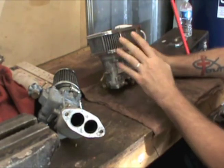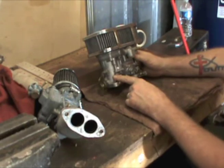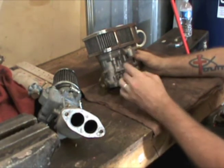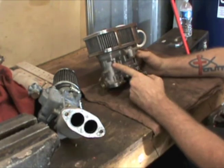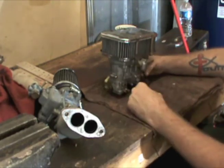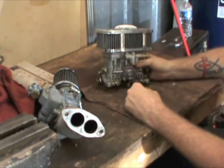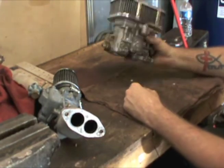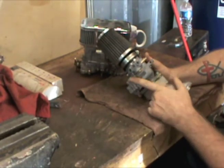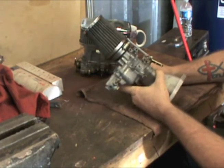I found IDFs are really good carburetors, but a lot of guys don't like the tuning involved. Some guys running sandrails and woods buggies will run a single ICT instead because they don't want the IDF exposed to all the dirt — IDFs don't tolerate dirt very well. The ICT is kind of like the Holley or Edelbrock: just a very dependable, solid carburetor all the way around.